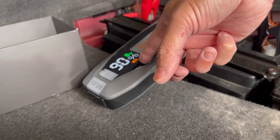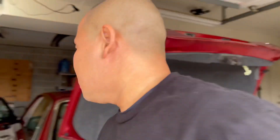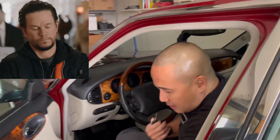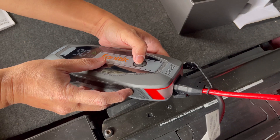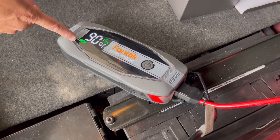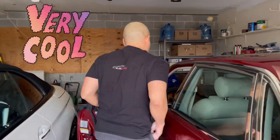It says the battery is too low. Before going to booster mode, Vantik says to try regular mode first. I try regular mode but as I predicted, a dead battery with a low voltage won't be jump started without the booster. So now I press the power button and the light button at the same time to activate booster mode.